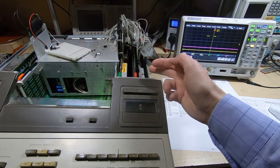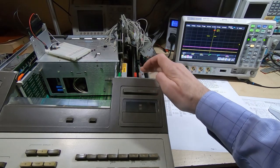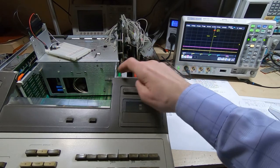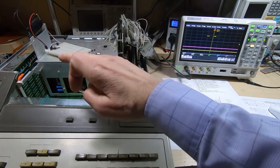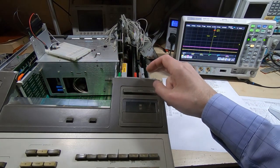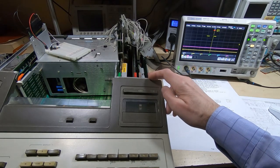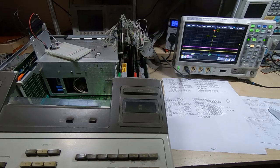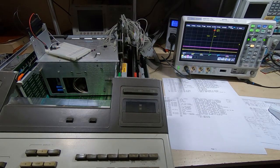There's boot-up code in block 5 that allows the two processors to figure out which processor they are — it sounds a bit weird. They look at the HALT line going into the hybrid module; it's not used as a halt line on this machine. On the LPU that line is grounded on the board itself, so always low. On the PPU it's connected through to the monitor and driven from the vertical drive signal — a series of low-going one-millisecond pulses once every 16.7 milliseconds. I've got a little breadboard arrangement that provides the required signal in lieu of the monitor, so the two CPUs can still start up even without the monitor plugged in.